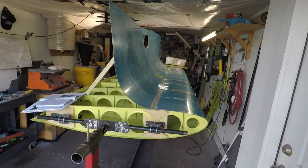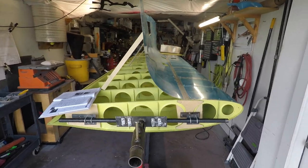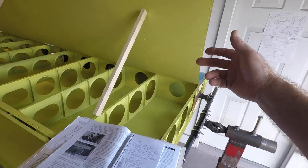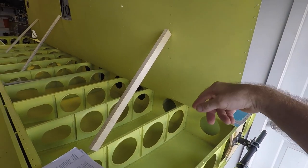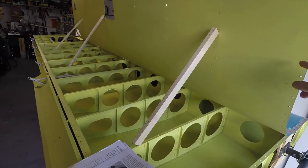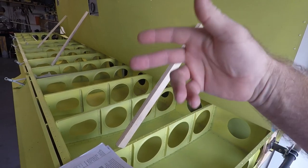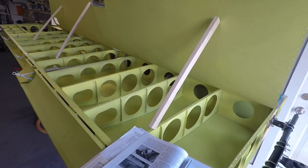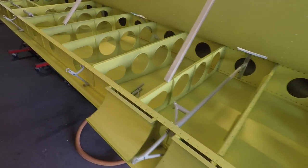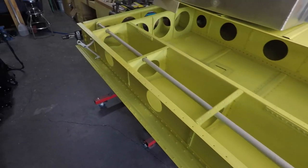You'll notice that when the wing is delivered, it is almost fully built. The only thing left to do is a lot of the internal functions — the skin, this final skin, will be riveted in place once we complete a lot of these internal assemblies. For right now the skin is just propped up. When it was delivered it was pop-riveted in a few places just to hold it in place; I've drilled out those pop rivets and propped up this wing skin so we can get to the inside of the wing.